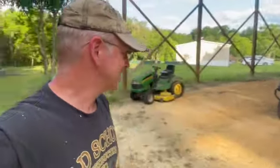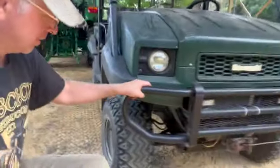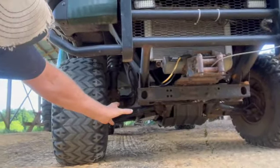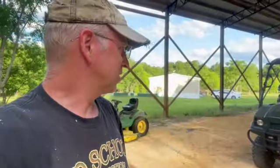You know what I left out? The Mule's back. Yes. Got it welded here. And that's a good thing. He got down inside, put a chain or a strap through and pulled from the other side, squeezed the whole axle back until it was back to its contact point, and then he was able just to weld the whole thing. He got to it pretty quick too, so I really appreciate that. And it was really just a half-day job for him. So it's good to have it back because I kind of count on it.